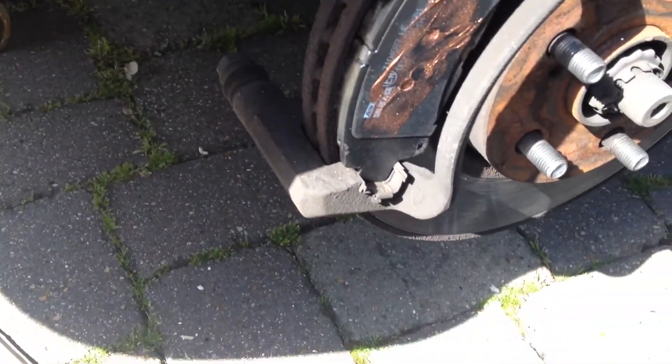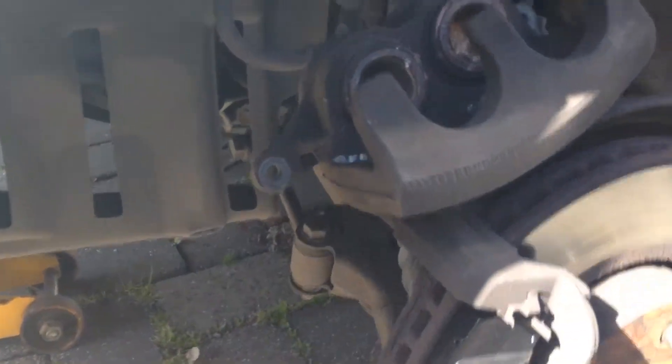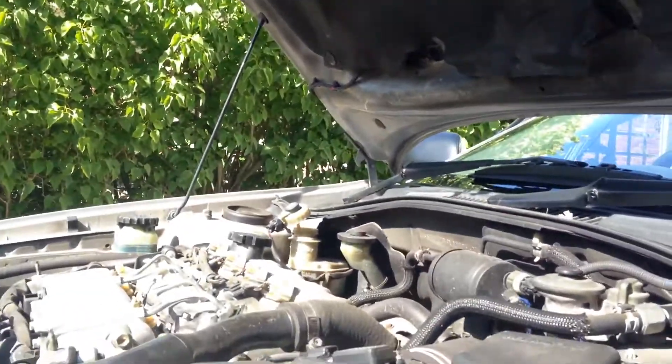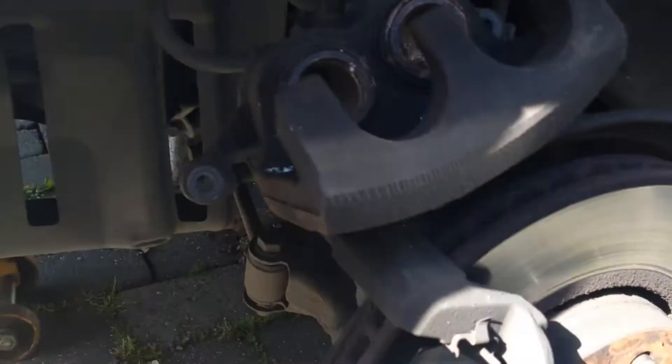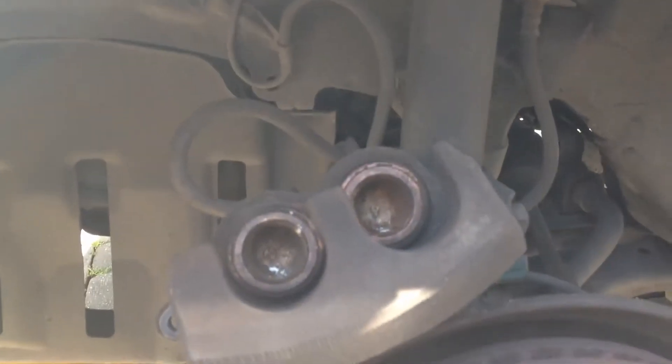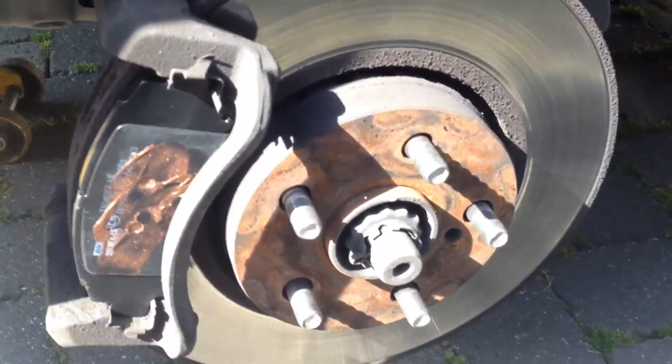Take a little bit of copper grease on the two nuts — the top and the bottom of this caliper. It's a 14mm socket. Take that off, squeeze the calipers in, check that you're not overflowing up on the top. Put the caliper back on once you've got the brake in without kinking the line — which I did once last time — and then you should be done.